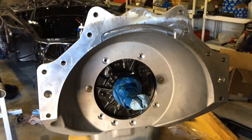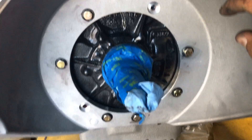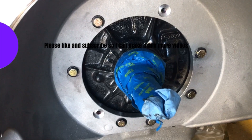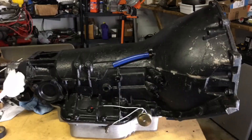Here it is, all done. I have all six bolts in with Loctite 277 and some black silicone around the washer. I torqued them down in sequence — snug first, then about 10 foot-pounds, then 20 to finish it out. I'm gonna let it sit and dry overnight, or really a week since I'm waiting for my torque converter. That's it.